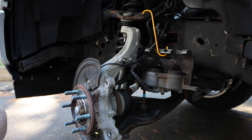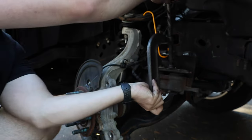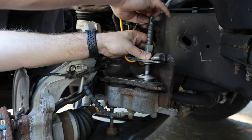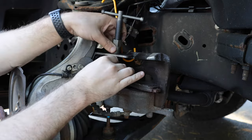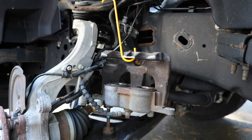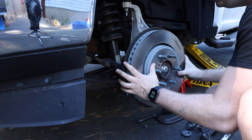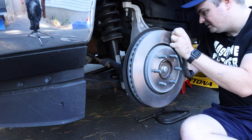So what we're going to do next is compress the caliper's two pistons. I like to use the brake pad that came with the kit. You can use a C-clamp like this and compress it, or you can use a specially made tool — I'm going to use the specially made tool. Now you can see we are completely compressed all the way in. We can go ahead and put the caliper bracket back on. I'm going to get the rotor on there first, as it's required before the bracket. Now I can put the caliper bracket on and tighten it down to the 184 foot pounds that it's supposed to be torqued to.